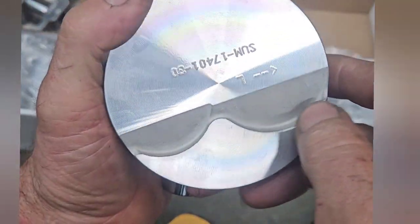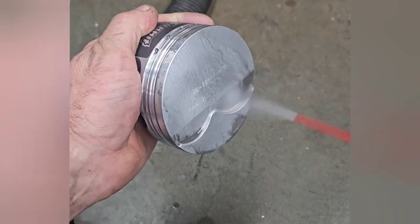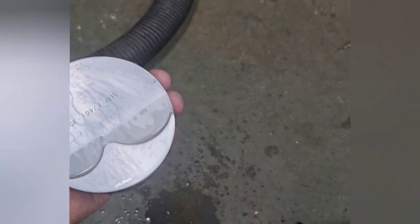This one's not super high horsepower, but it's going to be in a tow rig and it's going to see probably about 15 pounds of boost while towing. The last thing I do with pistons before I install them — just on the crown — I take a piece of ultra-fine gray Scotch-Brite and just go over the top. Now, if you have a coated piston, don't do this — you're just going to take your coating off. But these are just raw aluminum, and that stamping leaves some rough edges that all go away. It's nice and smooth compared to before. That's all you're trying to do — just get all the edges out. Wipe her down, spray it off, wipe it again.